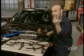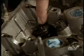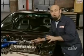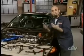All right, come back in here for a second. Follow me. See this right here? This is the valve. It lives in the middle of the spring. Now, once we take the spring out of there, gravity is going to take that valve and drop it right into the cylinder. So, short of turning the car upside down to do the job, we have to find a way to keep the valve in there.